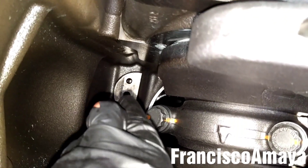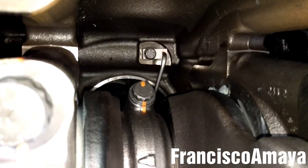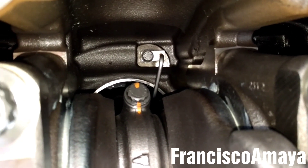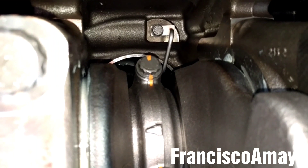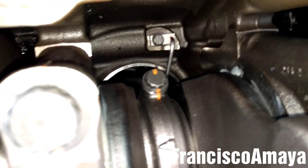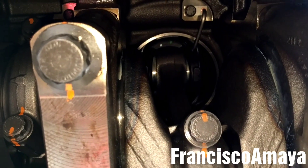There are six oil nozzles — one for each cylinder. Each one goes right here. You insert it like that and torque the bolt to around 22 to 25 pounds. Make sure there's nothing in between and clean the area very well. Do not forget to install these — if you forget and start the engine, it will run for a while but then start having issues. All the nozzles are now in place and torqued to specification, which is around 25 pounds.